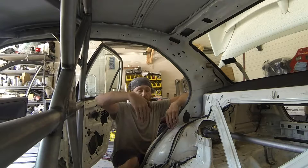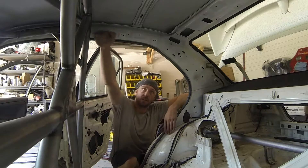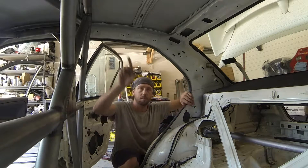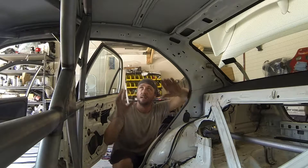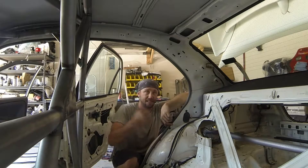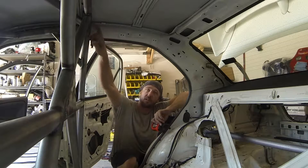When viewed from the top, the plane must be no less than 75 degrees and no more than 105 degrees. So when you're looking down, they can have no more of a swing area or an angle to them from the point where they attach to the main hoop. You can use an X-brace, which we're not going to do on this one, which uses two separate tubes and a diagonal, and they must be within six inches from the top of the main hoop.